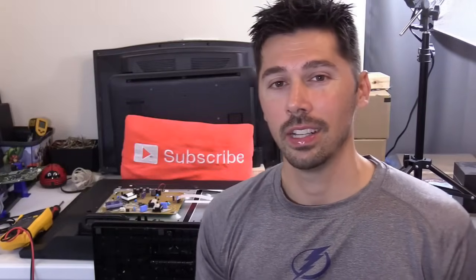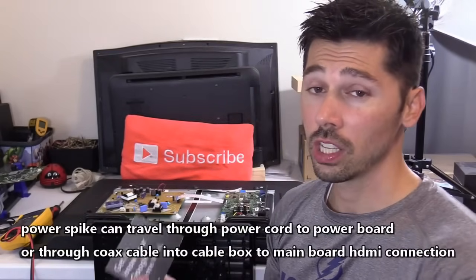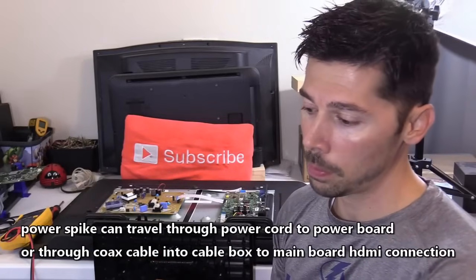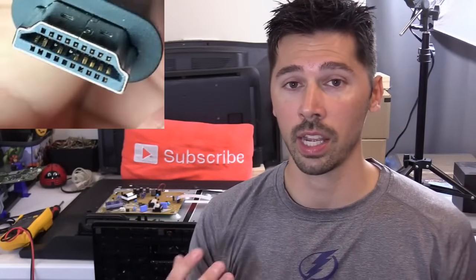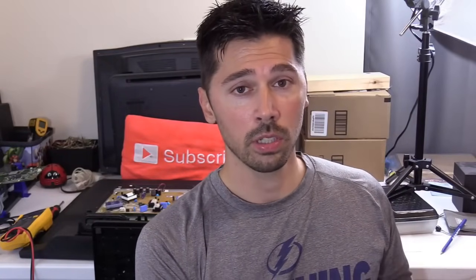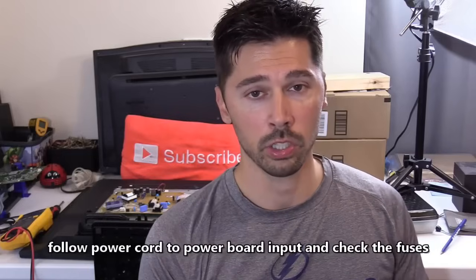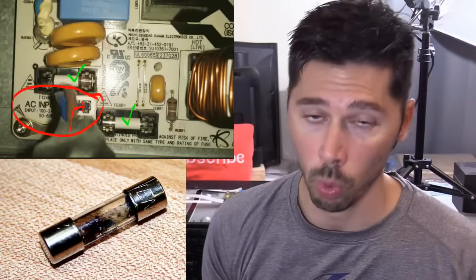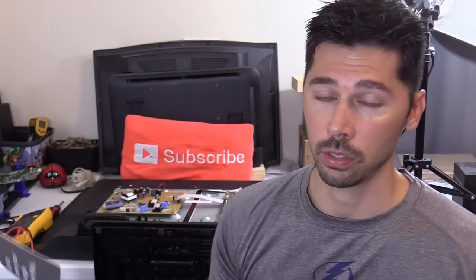Now, if you had a power surge, that can take out your power board or main logic board. If the surge knocked out your cable box but didn't trip the circuit breaker, usually the surge entered through the cable box, traveled through the HDMI cable to your main logic board, knocking it out — so I would replace the main logic board in that case. But if your circuit breaker turned off, I would focus on the power board, because the surge may have entered through the outlet and power cord, knocking out the power board. Or it could be both boards are defective — something to think about.